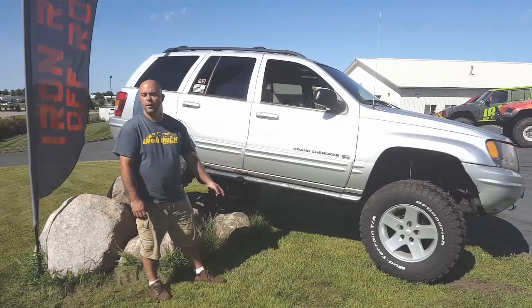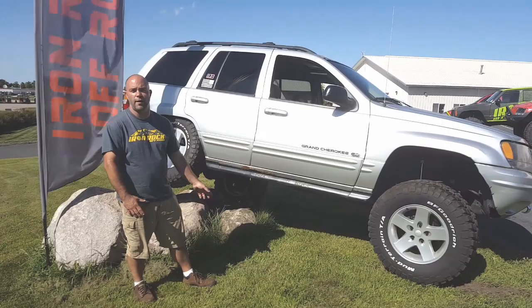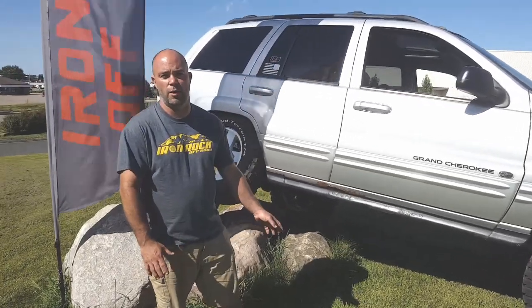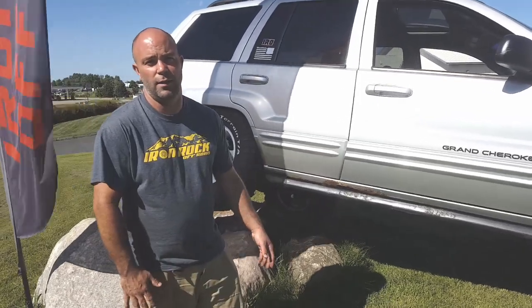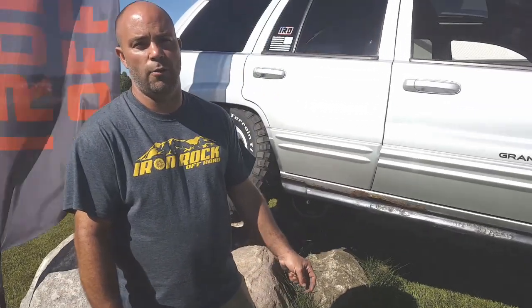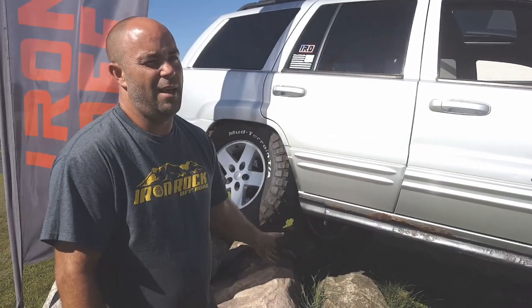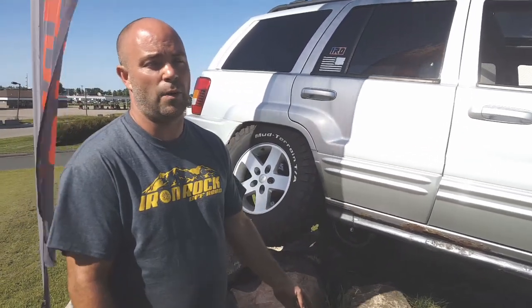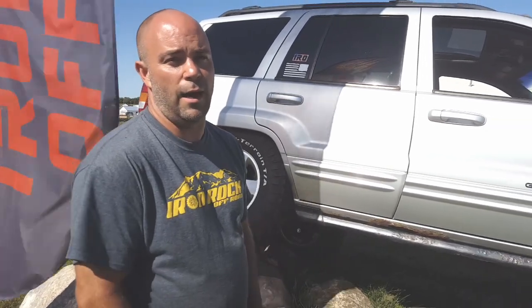It's got long arms front and rear now, so on the trail this thing is going to perform awesome. Our installation's all wrapped up. We took it for a drive on the highway and it drives just fabulous — so much more stable and in control compared to those factory worn-out rubber bushings. This is just an awesome kit: high ground clearance, converts it from an A-arm to a four-link for the ultimate in adjustability and axle swappability. It works great on the road and off the road.